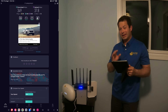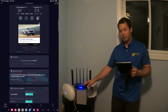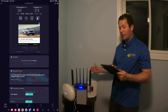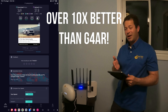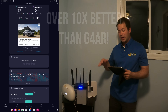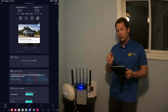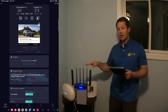That is a very strong demonstration of the benefit of being able to just change your modes and bands with a third-party router. My download speed is 350 — that's still excellent — and I went from very unusable upload speeds on the stock G4AR to now almost 40 Mbps upload. That's in the same location, not even with an external antenna, and this one without an external antenna actually beat the upload of the G4AR with an external antenna. That's really because I'm able to change and configure the settings for whatever gives me the best performance.